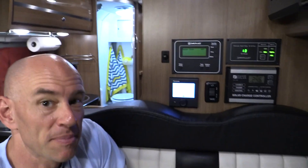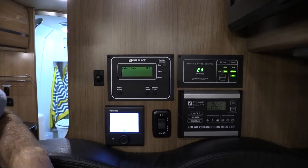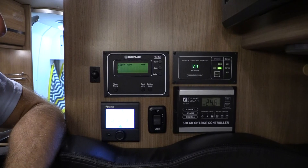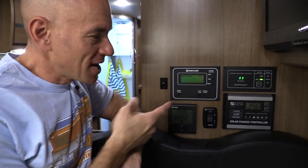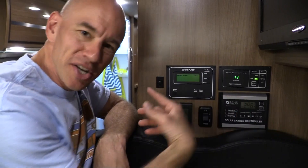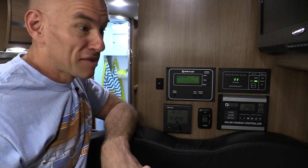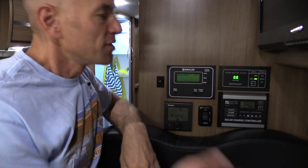So now I'm going to try something even a little more crazy — we're going to throw the microwave on and see what happens. Check that out! The microwave is still running, but it got up to like 24 amps. The EMS said it can't do it, so it shut down the refrigerator and had to shut down the air conditioner. And I'm pulling 11 amps with just the microwave. It's prevented me from tripping any breakers. All this stuff will eventually come on when I stop the microwave — after a couple of minutes to recover, it will cycle back on.